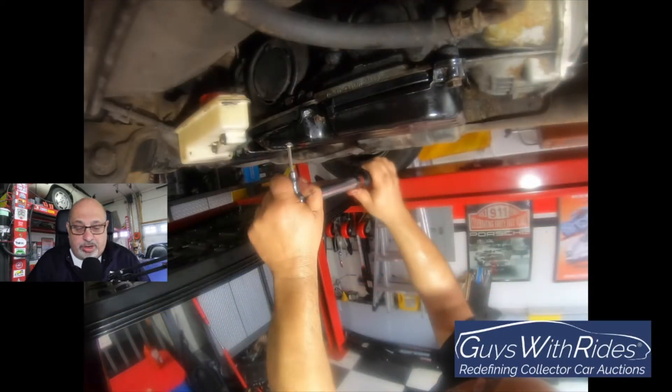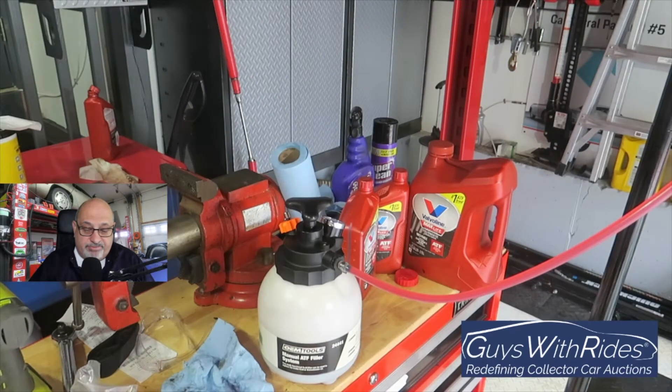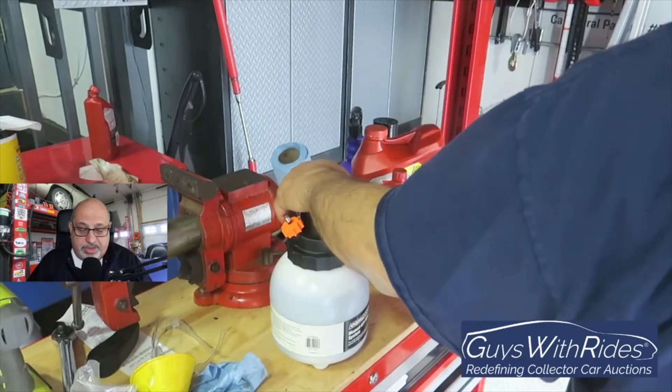That white reservoir is where you fill up the transmission fluid — this is one of the nuances of having the transmission located ahead of the rear axle. What I would call the automotive equivalent of a garden sprayer: you fill it with the desired liquid, pump it, and the hose connects to the reservoir and fills it that way. In this shot, you're seeing the reservoir tank with a remote hose that has a ball valve and extension. Around one of the rear suspension links, I used a couple of zip ties to hold the hose in place while I pump the fluid.